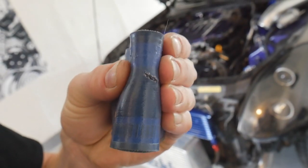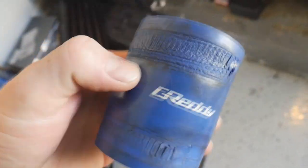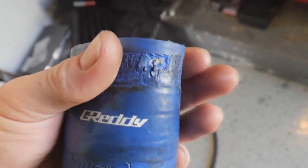TJ Hunt. But no guys, hopefully in this video we're going to be driving the boosted G35 at a safe 450 horsepower and just pray we don't start smoking again. I also found some boost leaks. So instead of it being a hurt turbo, it made sense - I found some boost leaks. We did lose boost power when we set it to 12 psi at the dyno and we were wondering if it's a hurt turbo or a boost leak somewhere. Thankfully, I did find a boost leak. I have this little coupler right here with a little gash in it - as you guys can see right there, it pierces all the way to the inside of it. So that was a major boost leak right there under pressure. And then we have this nice little coupler right here which is just completely beat up. So I ordered a bunch of couplers I'm going to be getting on today and I should be able to fix that boost leak issue.